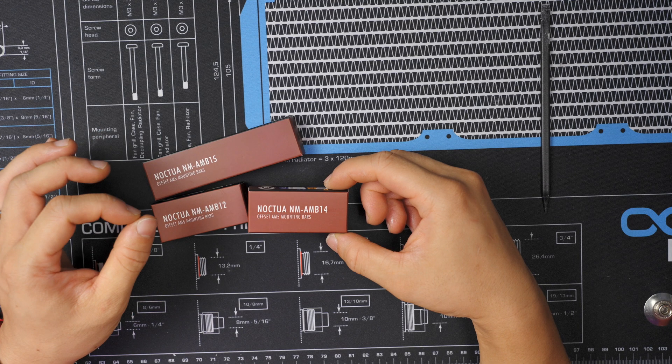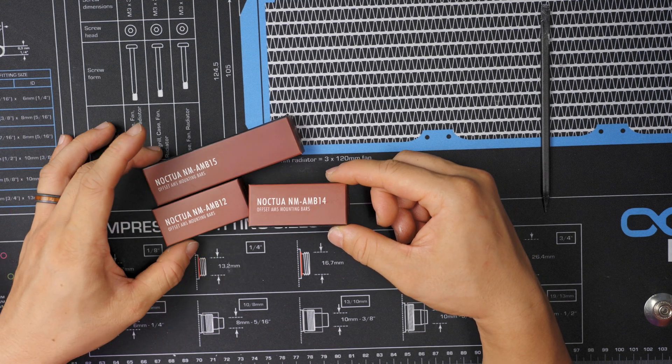With Ryzen 7000 you're mostly already operating at the higher end of the RPM spectrum, so a close-to-three-degree gap translates to a very significant fan noise reduction if you want to approach it that way. The naming could perhaps be better — they're called offset mounting bars, but multi-position bars might be more appropriate since they also let you fine-tune cooler placement for fitment reasons. Kudos to Noctua for adding a feature they really didn't have to. Dan told me at Computex that by the end of the year all multi-socket coolers will come with the new mounting bar. Simple, elegant solution — love it.